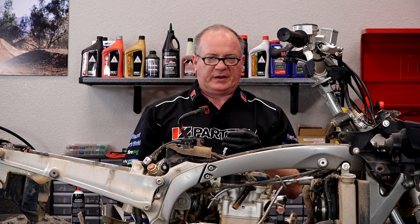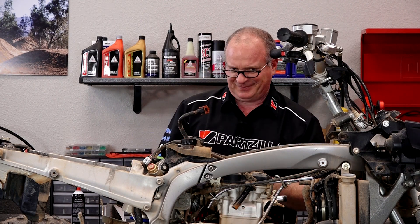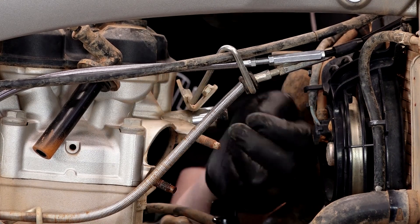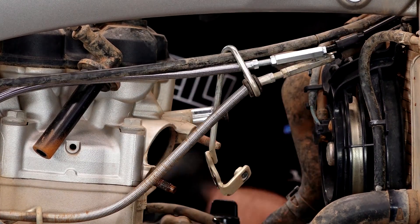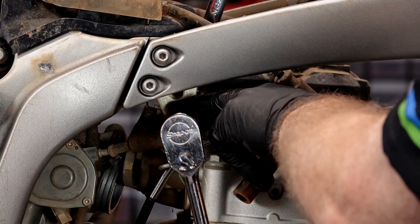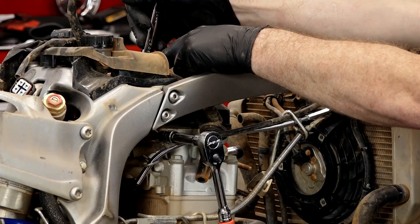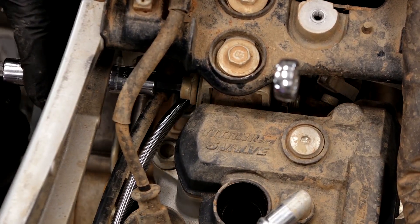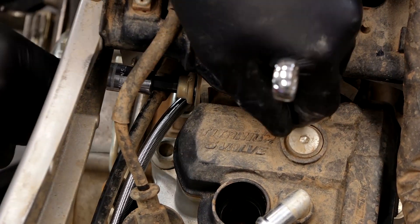The spark plug is wet — imagine that. We're gonna go ahead and finish getting these cable harness holders out of the way. That top motor mount actually has an 8 millimeter Allen on this side and a 14 millimeter nut on the other side. Once we get that bolt pulled through, we'll pull these two top ones and that'll get the bracket out of the way.